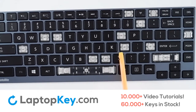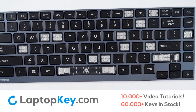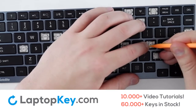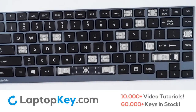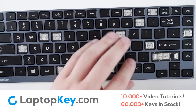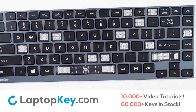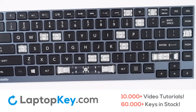Next, we will repeat the process for the standard size keys. Simply take your clip with the notch on the outside facing upward. Align with the holes to hook in. Same for the opposite side. Replace your rubber cap, if necessary, directly in the center. Take the key, place on top with a firm press, and the key is functional again.